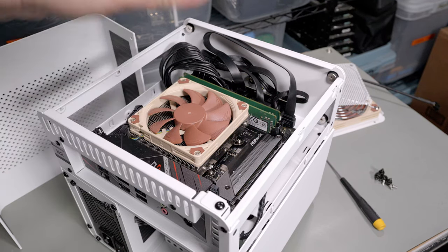I don't know why they didn't provision space for a fan here. They have space for the 2.5-inch drive with mounting holes, but there aren't corresponding holes at the bottom — so just two screw holes. I'd be perfectly happy if they just had a mount here for a 40mm fan, ideally with mounts in all four corners so you can choose wherever you need cooling — whether for a SAS controller, VRM cooling, or just air circulation. Give us options.